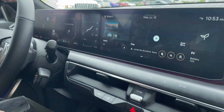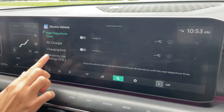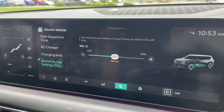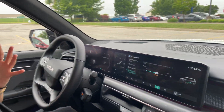Before we save the day we just want to make sure that we'll still have enough range to get home. So we're going to go to the EV menu on our car, then this charge icon here, and then electricity use settings. From here you can set the max percentage you would like your vehicle to power other devices until. Right now I have it set to 50, which means my car will not go lower than 50% battery charge.